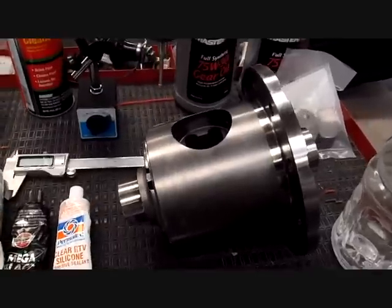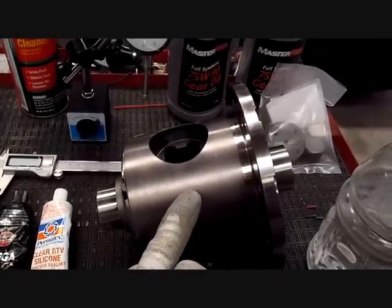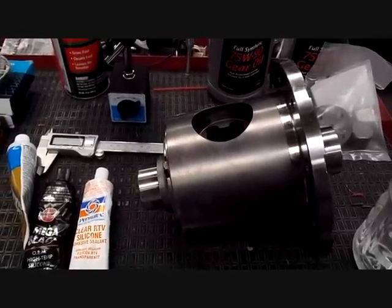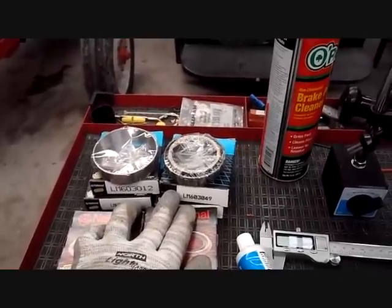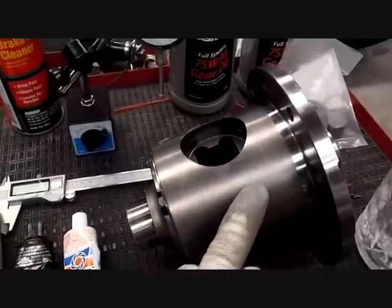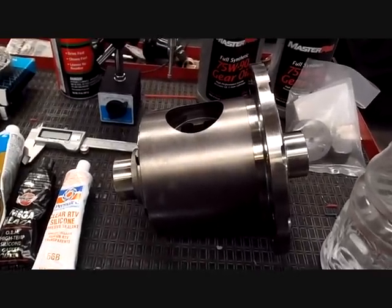Year 2000 was the cutoff date. When I ordered this, I told them what I had and they sent me the smaller bearings. As I researched more, I found out it was probably the larger bearings, which that distributor didn't carry. So I went to O'Reilly's, told them I had an 8.625 differential, and they actually had these bearings and races in stock - cheaper than the online source. So I'm covered both ways. That was a little tidbit if you don't know what differential you have.